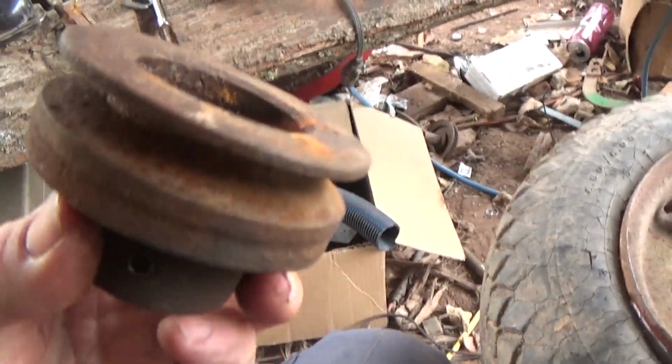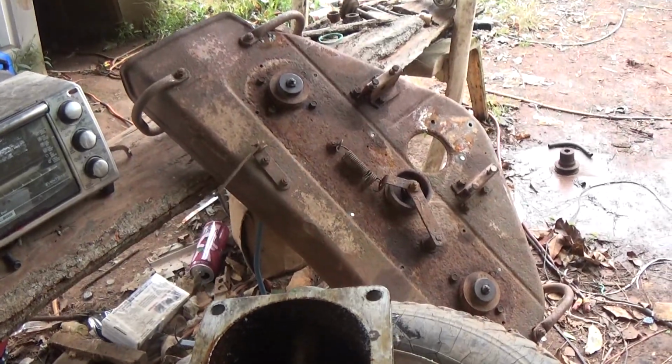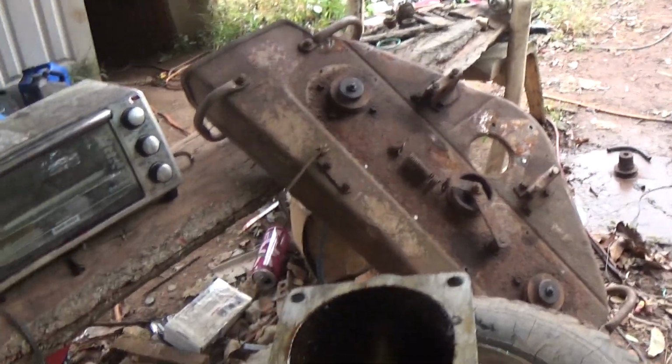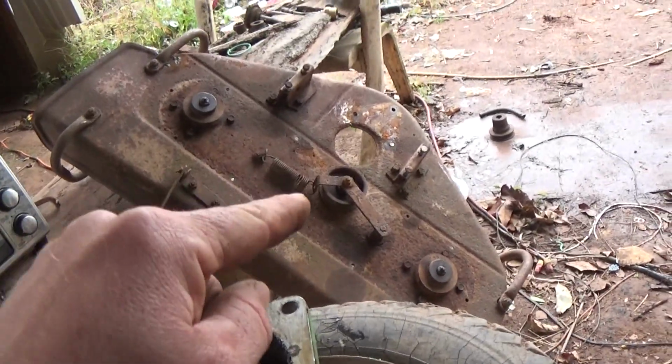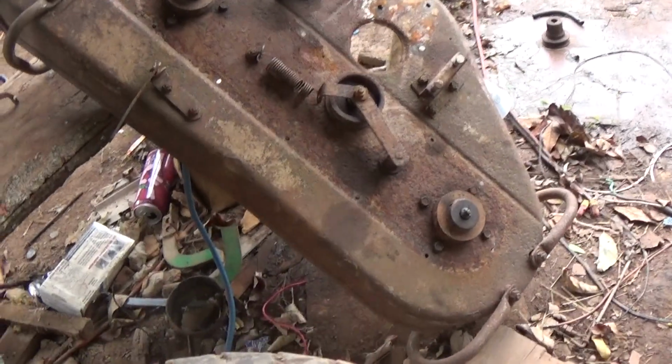That's okay. I still have it, and I could someday get 3/8 pulleys for that thing, and I could put it back the way it should be, but it's not really an advantage to have a 3/8 belt on the deck compared to a 1/2 inch. And I've been looking at that pulley setup. It definitely doesn't work the way it's supposed to.